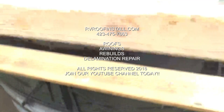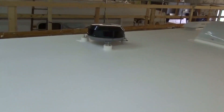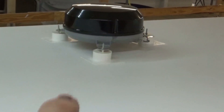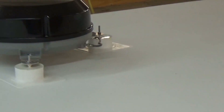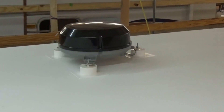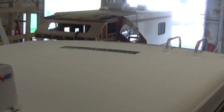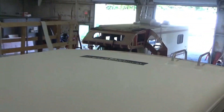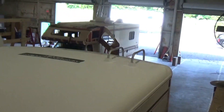This is our Winnebago Adventurer update — we are done. Got the roof all glued down. Got a nice Winegard antenna — you can see the way we do the antennas right there with the little bolts. If you ever have any trouble with these antennas, just undo those bolts, buy a new antenna, put it down, and then undo that coax on the other side — they take about 10 minutes to put on. 60 mil TPO commercial grade roof is what we put down on here. You can see we've got all our curbs welded in, everything all welded in over here, and we've got our brand on here.